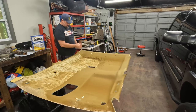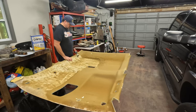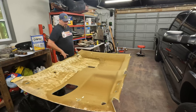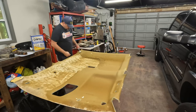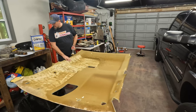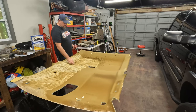So this stuff, it's not actually generating that much heat. This stuff's actually much more resilient than I gave it credit for. I'm still gonna resist that temptation to bump the speed up on this and go to town, because it will test your patience for sure. But it is going fairly well. If you have a bigger wheel, it'll probably be okay, but just be careful and keep your eye on what's happening here. If you start seeing some of this stuff peel up, boy, stop there.